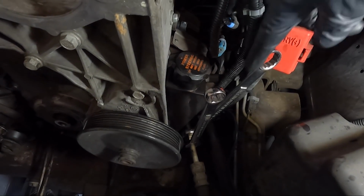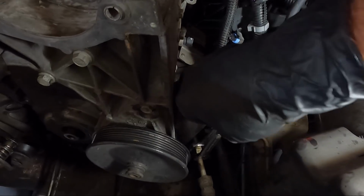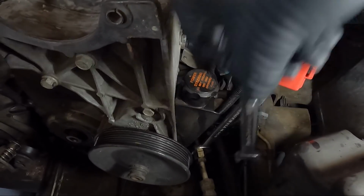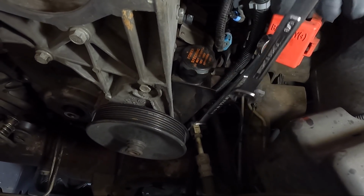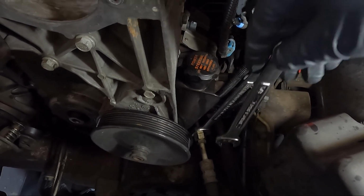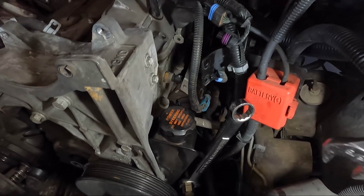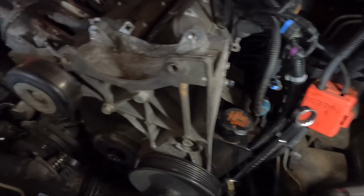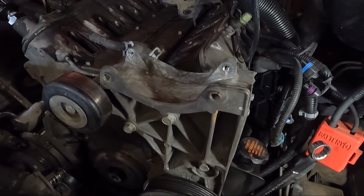So guys, actually what's fitting the best is 3/4 on the back side there, and then 5/8, you can see how tight, snug that is. 5/8 on the front, the actual piece that we're pulling out. So I'm using the 3/4 to hold it, and then we're gonna go ahead and thread the 5/8 out. And then the one right behind it is just a clamp, so we'll unclamp it, pull it apart, and holy cow, will we have a mess then.